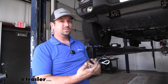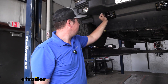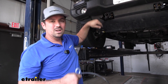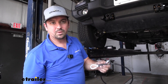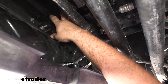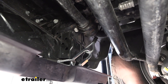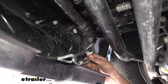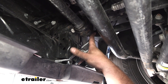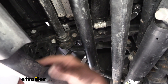Now we need to put our safety cables in place — these need to wrap around the base plate and also structurally to the frame of the vehicle, so that if the hardware were to completely fail it would still keep the base plate attached. There is a body mount on the frame rail you can wrap around, as well as the cross beam. Loop the cable around, put your quick link in place. I looped mine through the gap between the AC condenser and radiator, then around the cross beam. These are just there in case of an accidental disconnect, so if it is loose you can zip tie it for tidiness. When routing it, make sure it won't contact anything moving — watch the sway bar and any belts if you go too far into the engine bay.